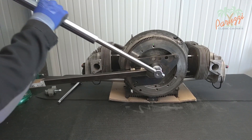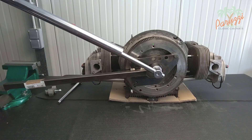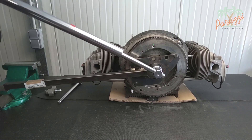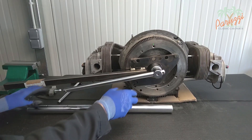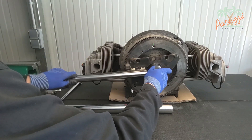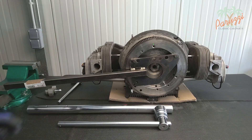You can rest the end of this tool on your workbench or on the anvil of your vice. Using a 36 millimeter socket wrench and a power lever at least one meter long, the gland nut with some force applied comes loose. We use an old motorcycle fork tube as a power lever extension. The gland nut can now be unscrewed with the socket wrench, and then disassemble the safety bar.